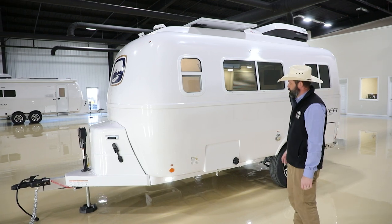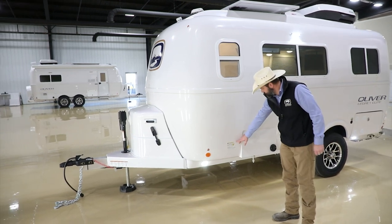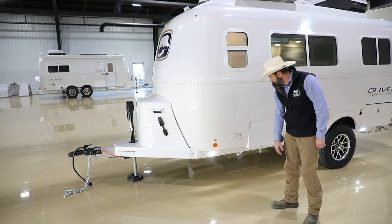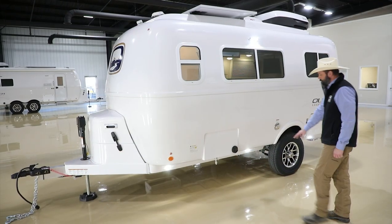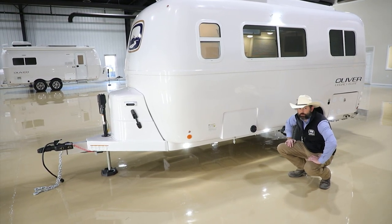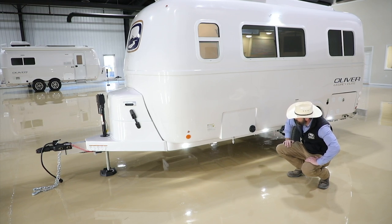Here on the street side of the camper, over in this area is where the furnace is located. You'll notice the furnace vent when running — this is very hot, so don't touch it. To the left is your tire loading information and a VIN sticker with the VIN number and production date, tire pressure, and weight rating for cargo. If you look underneath where the furnace is, you'll notice a water inlet connection for the black tank flush port. You'll typically only utilize that with the standard toilet — if you've upgraded to the compost, there may never be a need to use it.